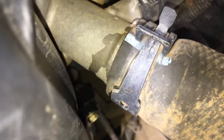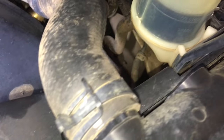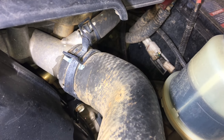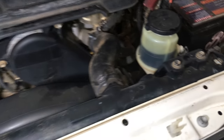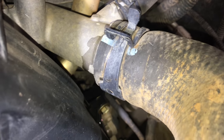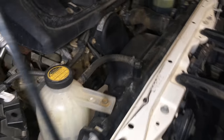The key is that the clamp is in a good position - just on the edge of the ridge. There's a little ridge just on the inside of the clamp on the end of the radiator, and same thing on the end of the alloy. All the genuine hoses have white marks on them to tell you where the clamp needs to be. You can see that white mark - that's where the clamp goes. I butted it up all the way to the plastic and alloy. We only lost probably 20ml of coolant in total, and it's still a little bit above the full line.